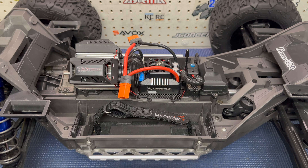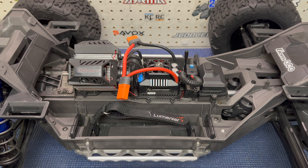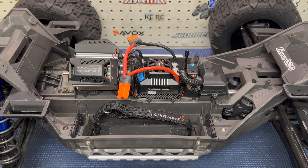When it comes to the Max 6, in my opinion it is a must-have upgrade. The VXL 8s is junk - it bothers me that they release such a great truck like the XRT but make you spend money on their electronics because they released it RTR. My VXL 8s right from the beginning was giving me issues: it would cut power, threw different fault codes. It happened at different periods - could be 20 minutes in or one minute in, in warm weather or cold weather, running paddles or Method RC belted wheels. It wasn't thermal shutoff from holding it pinned in deep snow - it happened at all different times.